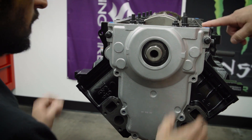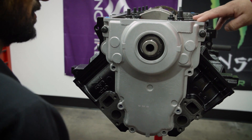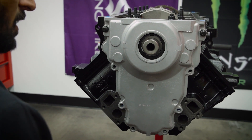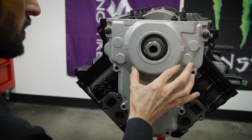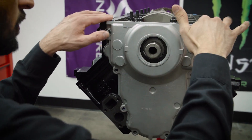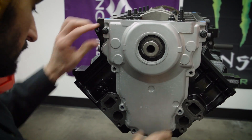You can see the rail on the block is a little proud. If you imagine the oil pan going up on there, there's going to be a little bit of space, and that's not good for leaks. As it sags right now, it has plenty of movement, and we need to account for that with our fixture, which we'll do in just a second.